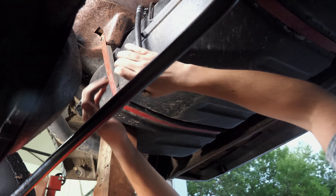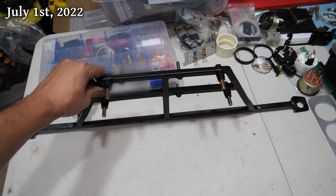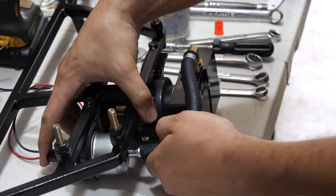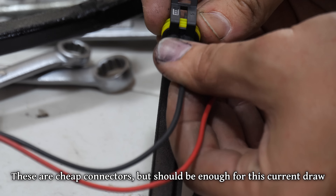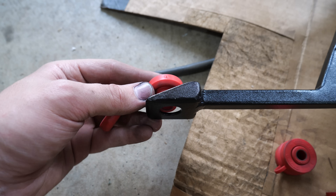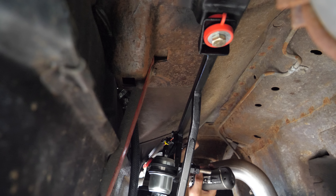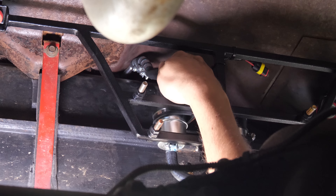Once the gas tank has been fully reattached to the car, it's finally time to assemble the fuel pump module for good. That means bolting on the filter and pump, installing the inlet fitting as well as a short section of hose between it and the filter, followed by the outlet fitting, and installing a sealed connector on the fuel pump wires. With those protected and secured we can pop in our mounting grommets and hopefully for the last time bolt the bracket to the body of the car. With all three mounts tight we'll cut the inlet hose to length and attach it to the fuel filter.